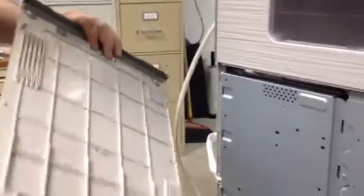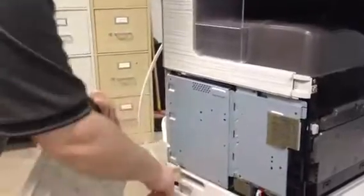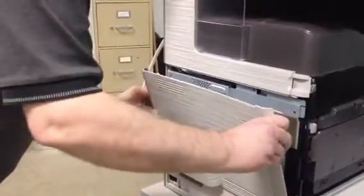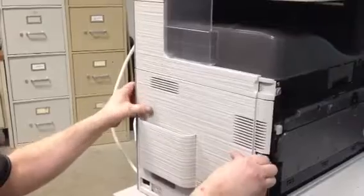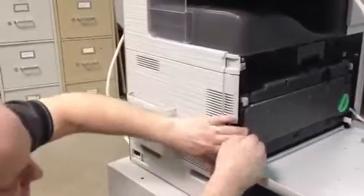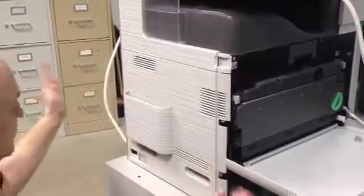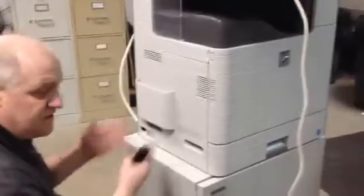Let me grab the side cover. The side cover also has little ears that need to fit in to hold it into place, and then there are plastic clips for the front. I typically start by lining up the bottom one because I can see it easiest. Get that ear in, then slide the whole unit towards the rear of the machine a little bit. Sometimes it takes more than just a wiggle — there we go, now it's snapped in. At this point, you have changed the hard drive.